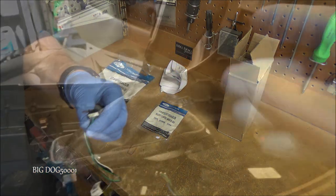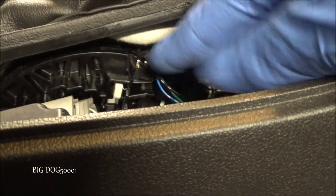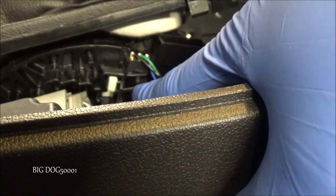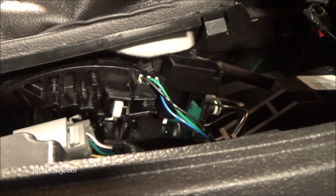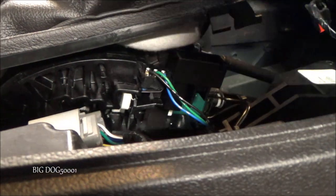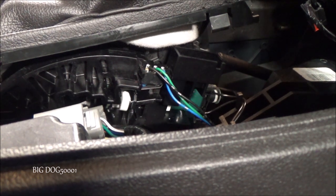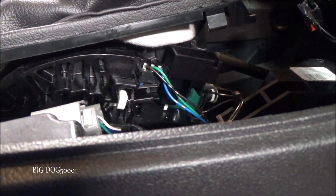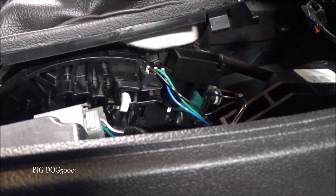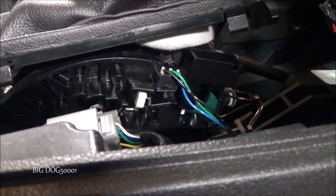Let me show you how this works in the car. I'm going to press this and we're going to watch this white piece connected to our shift knob, and watch what it does with our switch. There's our switch and here's our piece of metal — it's going to press on it. I'll just press the button and you can see what it's doing: it's just releasing it. There's a spring-loaded mechanism that springs together, and when I press it, it releases just like that. The contacts are probably bad, so it's not making a good complete circuit — the computer doesn't see it and gives you that error message.